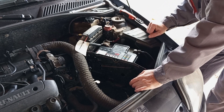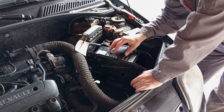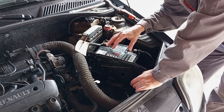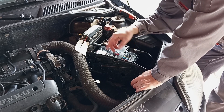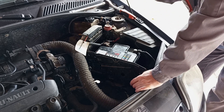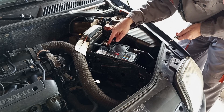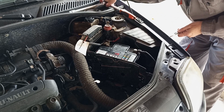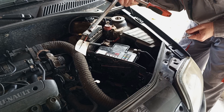We're going to take out the battery. We made a video about charging the battery while it's still on the car, but I always recommend that if possible — especially if you're going to charge it at home overnight — take the battery out and charge it away from the car. For removal you'll need an 8mm and a 10mm spanner, plus a ratchet with an extension and a 13mm socket for the battery holder at the bottom.